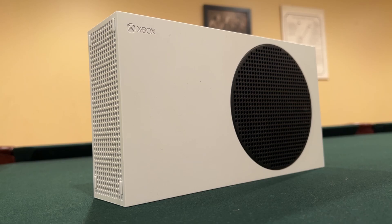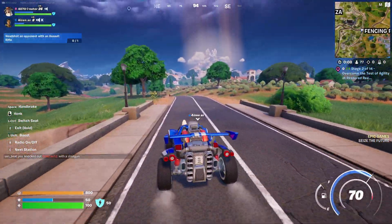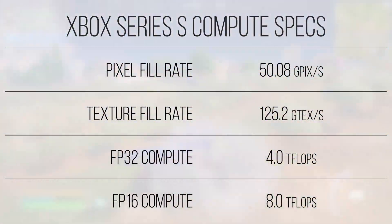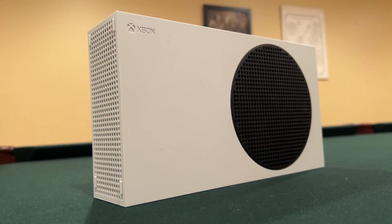Along with the relatively powerful CPU, you get 20 active RDNA 2 compute units clocked at 1565MHz. This GPU supports all the latest DirectX 12 Ultimate features, including variable rate shading, ray tracing, and mesh shaders, meaning it will be supported in hardware for at least a few more years. Where this GPU falls short of its desktop counterpart is the 2 megabytes of level 2 cache and no level 3 infinity cache, which limits it more to memory throughput. Developers do seem to be finding ways to make this GPU output interesting effects. The Series S delivers next-gen pixel quality with last-gen pixel count.